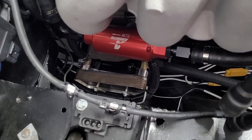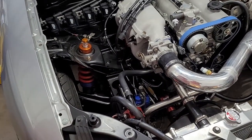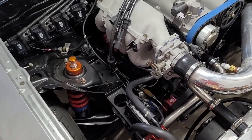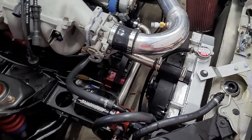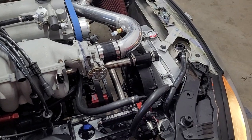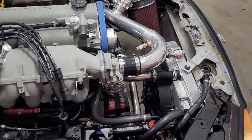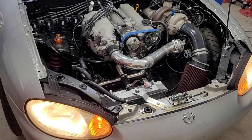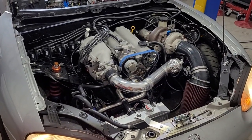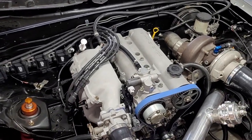Eventually the cooling fan and trans cooler valve will be computer controlled. The cooling fan pulls essentially 20 amps at 15 volts — that's over 300 watts — so it'll have an auto system down the road. But we're going to get this thing running first. The cooling system just needs coolant poured in, the fuel system needs fuel poured in, and we still need to bleed the brakes. Electrically the car works except for the engine side — I think that's all that's left.